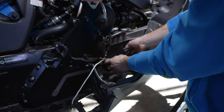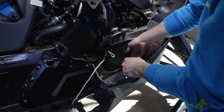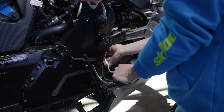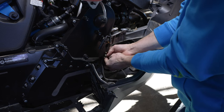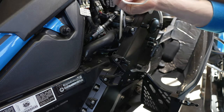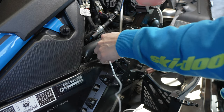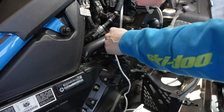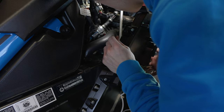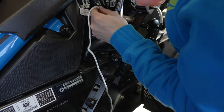If you guys are having any problems, maybe start it on an angle when you're going in, then turn it in just like that. We'll go ahead and fish our pull cord up behind the chain case. Now don't pull too hard — you don't want the knot on the recoil to undo itself just yet. We'll put the bolts on before pulling and undoing that knot. We've got the pull cord pulled through, going up without any interference.